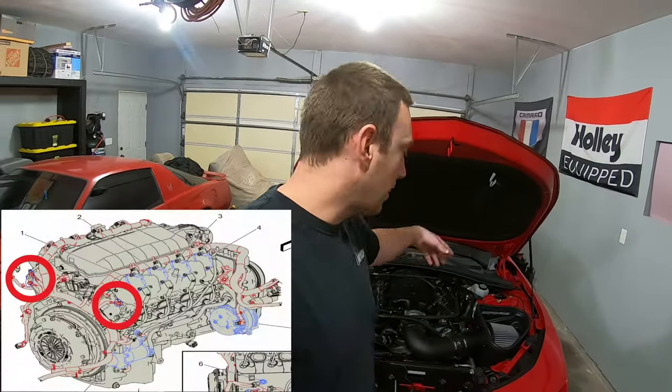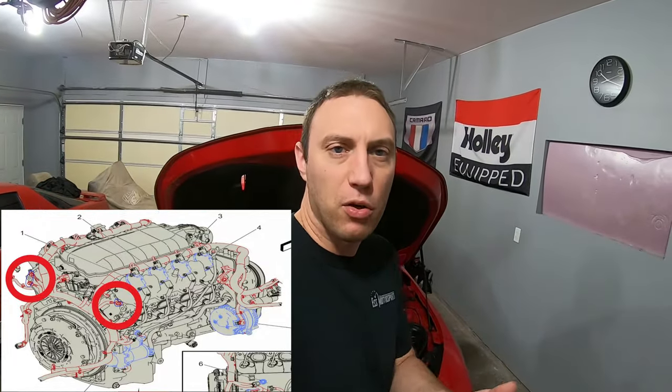I don't have any of those issues myself, but I want to make sure I'm covered. It's an easy thing to do to add a ground and prevent future issues. I'm going to add an extra ground wire, check the electrical ground points on the back of the engine on both sides to make sure those are tight, and eventually add an extra ground cable in the trunk area. The factory ground cable appears to be four gauge, which really isn't that big for starting the vehicle.